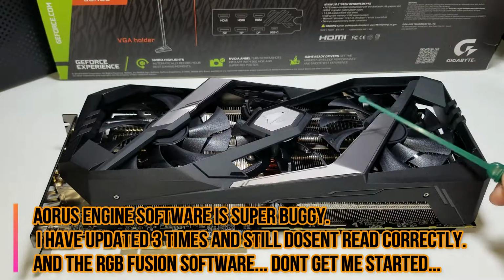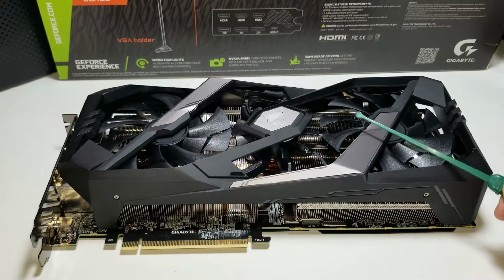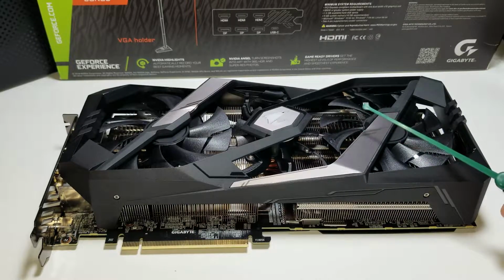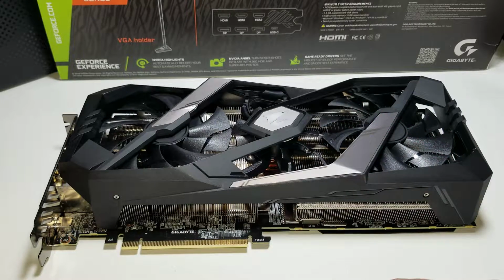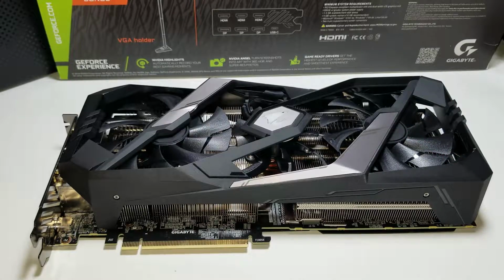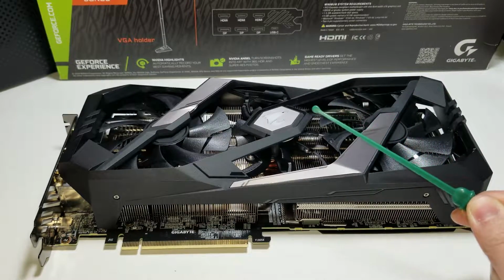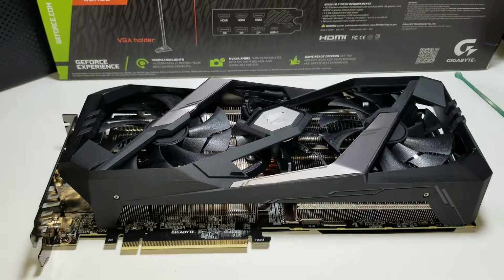And the reason why I've dialed it back from 80 to 60, from 8,000 to 7,800, is I did the Heaven benchmark and the Valley benchmark. I did some gaming myself. And I've done the benchmark 10 times and I did the average of the 10 runs. From all the benchmarking, I've noticed that the higher I go, at least plus 60 to 80 and 7,800 to 8,000, no improvement.